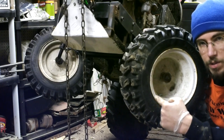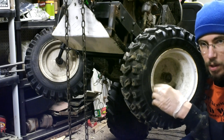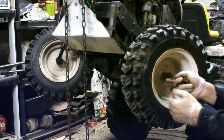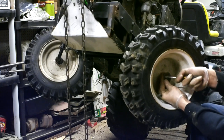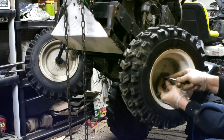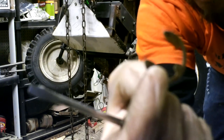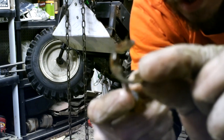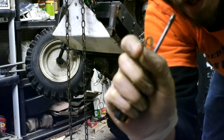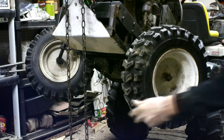At this point we're going to drop this whole front steering clip. I'm going to take these tires off to get some weight off of it first, because this is a cast iron front axle and it weighs quite a bit more than a regular stamped steel one. If you've never taken these off, they're quite simple. You've got a C-clip here — just set your screwdriver in the C-clip, give it a pull against the axle, and pull against the other side. Then behind the C-clip you've got a big washer, and then you just pull the tire off.